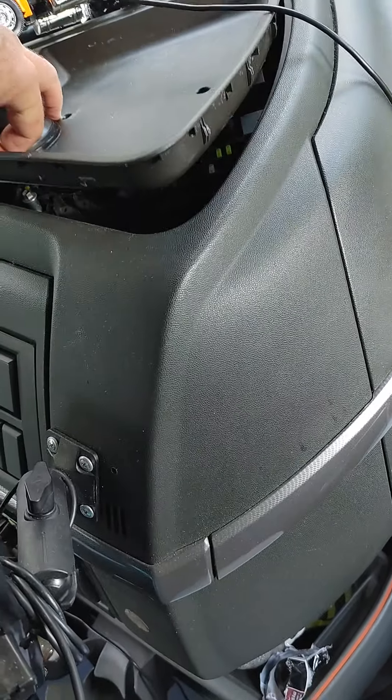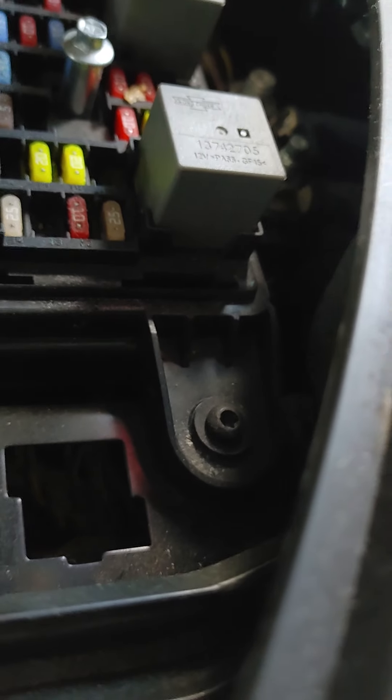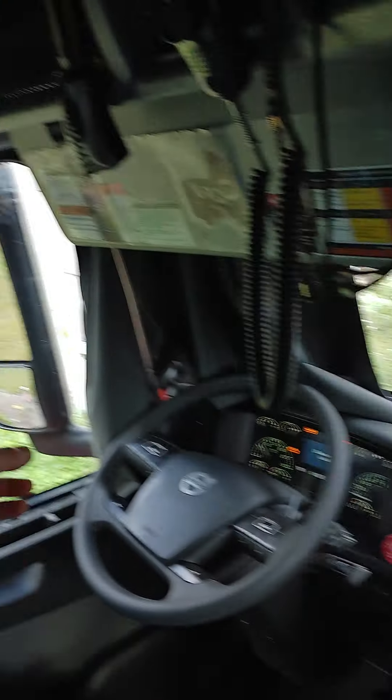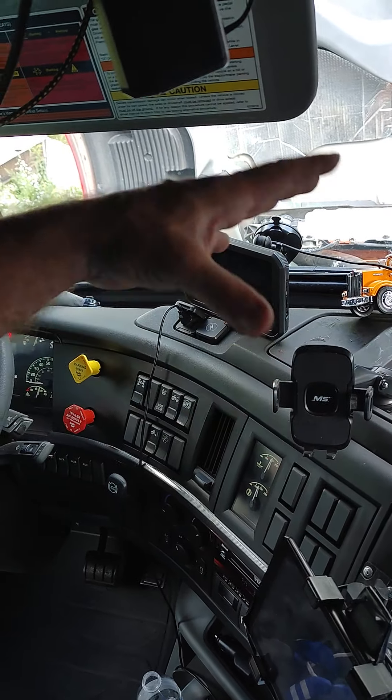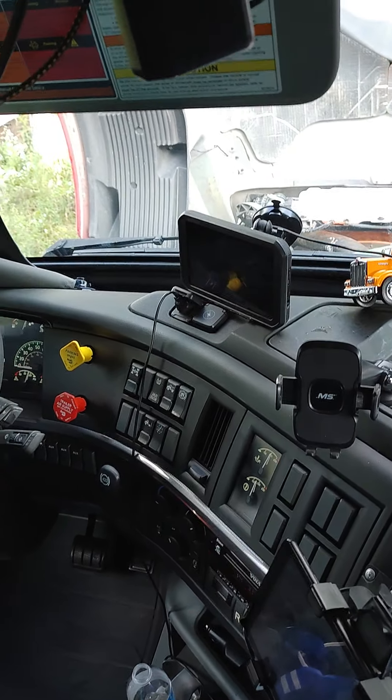To here — we got two hookups in there. Go straight to the battery. I'm going to hook the positive up, and I'm going to run the negative down to the frame and ground it at the frame instead of right there. Cause if you don't, every time you roll these windows up and down, you're going to hear it in your radio, cause you're grounded on a power source for the computer of the truck and it hears everything. If you don't ground it to the frame, you're going to have noise. Ground your radio to the frame — it's fine.